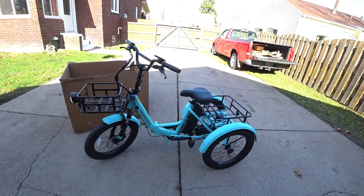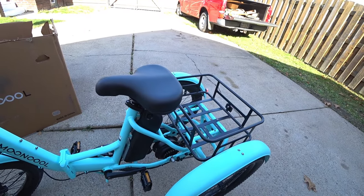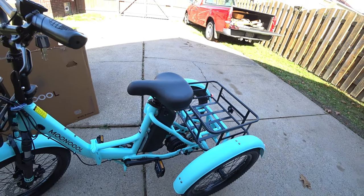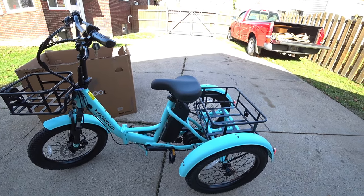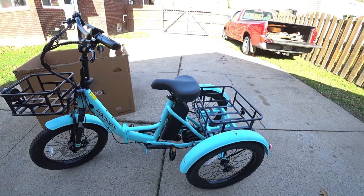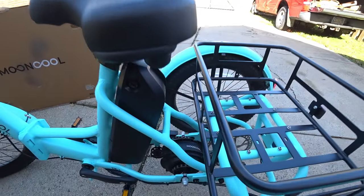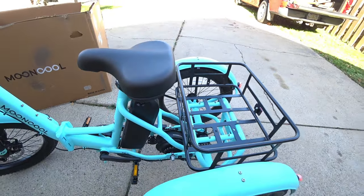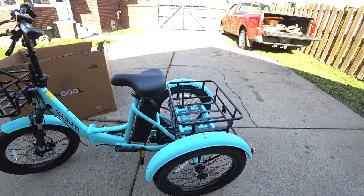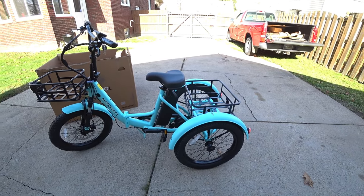You know what I think it is? I think it's the gearing. I think it's a gear reduction thing. It's a low end gearing that they have. Remember, this doesn't have a shifter on it. This is just one single pedal speed. But the fact that they've got it going through a jack shaft here, the electric motor, I think that they can dial in the amount of low end torque that they want. And it is a torquey little bike.